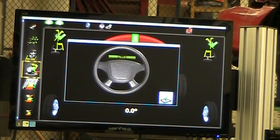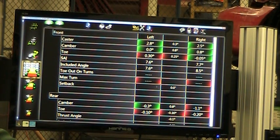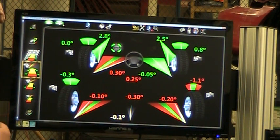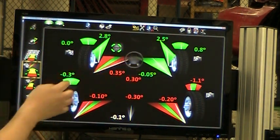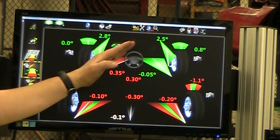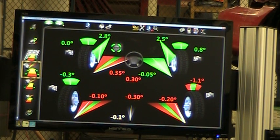I'll tell the computer I'm done with those steps by clicking the check mark. These are my alignment angles — green means things are good, red means things are bad. Hitting the green next button gives a better graphic view. The camber is good on both sides, the caster is good on both sides, and the toe on the passenger side is good. However, the toe on the driver side is off. The white needle indicates where the tire is pointing, and I need to bring it outward a little bit to get it into the green area. The next step will be to lock the slip plates, raise the car, and adjust the tie rods to get that wheel pointing straight.